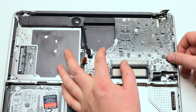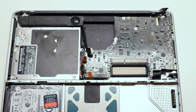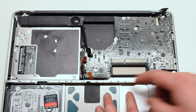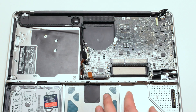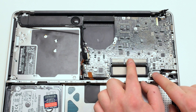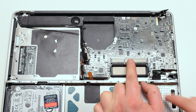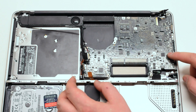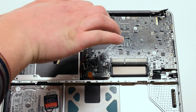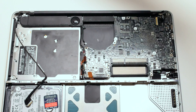Check the battery meter, the battery charger, the keyboard, the trackpad, the LED light, the SATA drive, the SuperDrive, the iSight and Wi-Fi camera, as well as the speaker. Carefully tuck in your battery charging cable, then make sure that your battery indicator cable is also plugged in. Reattach the five Phillips head logic board screws, again starting with the closest one to the fan.